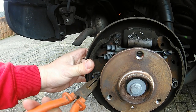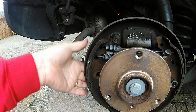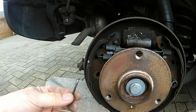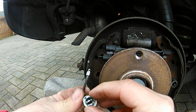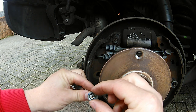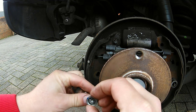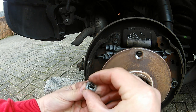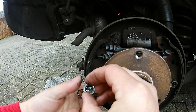These are the locking retaining pins and they lock the brake pads in position. They're a bit fiddly but not normally seized. They're on a spline or shaft but they've been flattened. The flange they go onto has a hole in it that only allows the pin in one way. When inserted from the back of the brake drum and twisted, it cannot pop off, and with the spring acting against it, it won't come out. You have to line it up and twist it 90 degrees, then it won't come out.